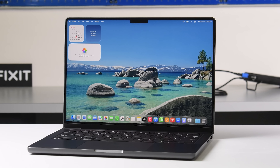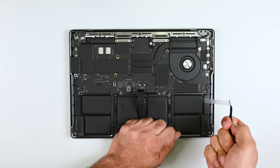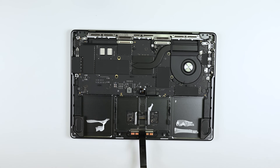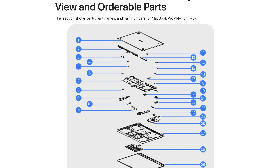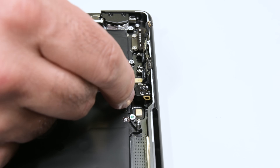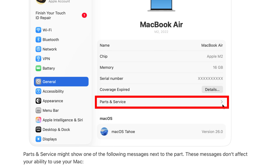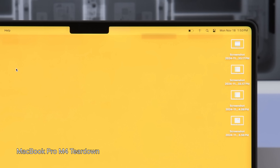The MacBook Pro M5 isn't a groundbreaking new device — it's an iterative upgrade, and that goes for repairability too. It's really nice to see a simple improvement like bringing all the battery pull tabs within reach without removing the trackpad, so if Apple ever releases the battery as a standalone part, that repair would be simplified. Apple's day-one release of manuals is delightful — it's great to know which spare parts will be available before putting your money down. The ports and fans are replaceable but still buried under the logic board, meaning anything other than a lid-angle sensor or trackpad replacement is complicated. Thankfully, parts pairing is now a minimal niggle, with Apple's repair assistant handling calibration, including a resolution for screen artifacting that has been plaguing display replacements.